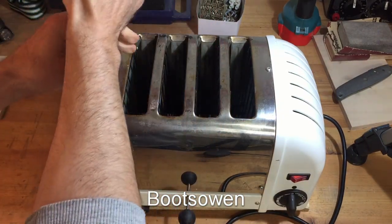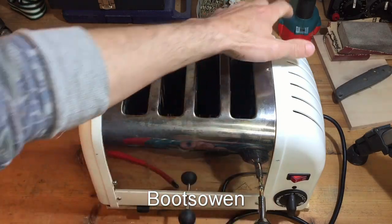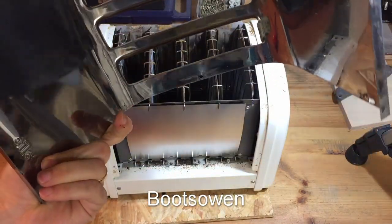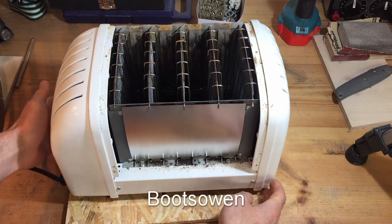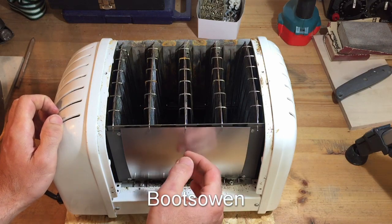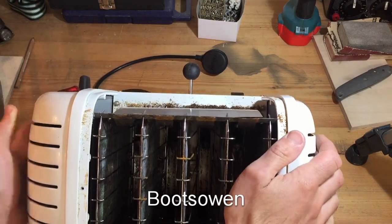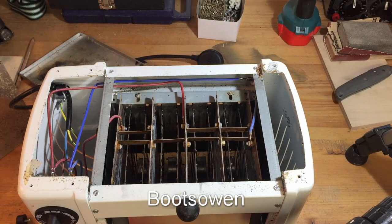What I'm looking for today, given that I found it on the street, is any signs of a problem internally. Because it's a posi screwdriver, I should use the electric one — it's far faster. It's a bit sticky, but that's just from toast I guess. When I found it today, it was wet. It's all metal so far — a lot of modern toasters are plastic. These are what look like cast aluminium ends on it, aluminium base, little bits and bobs in between. The obvious way to get to the elements: looking down into it, elements have screws at the bottom. Let's try and get the bottom off and have a look in there. So I didn't need to take the top off at all.